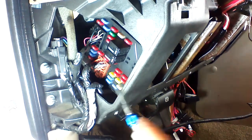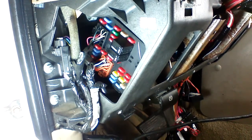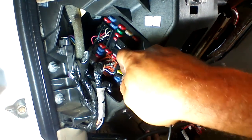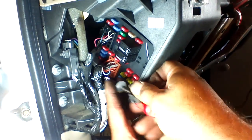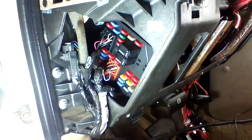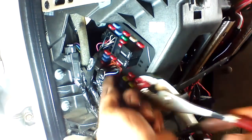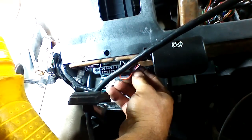Here's a spot where I like to get the brake — you can also go to the brake pedal. There's a white wire right at the pedal switch. This wire will test positive when you press the brake. Our last connection will be at the diagnostic plug of the vehicle. Down underneath the dash at the diagnostic plug, I'm going to locate the violet wire.